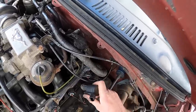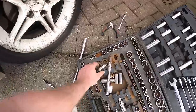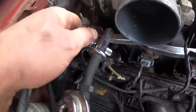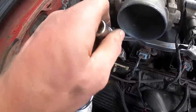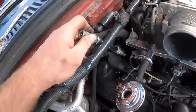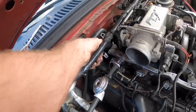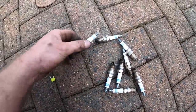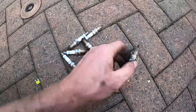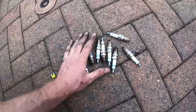This last cylinder isn't being very nice to me. So you see the trouble I just went through — someone didn't do that in the past because it's a different fucking spark plug in that cylinder, that's been in for about seven years. This is one of the worst designed engines I've ever come across in my entire life. Seriously, this is an absolute piss — I'm going to have to grind this down even more. I got them all out, nothing looks too suspicious to be fair, they all look pretty similar. One of them is a bit black which is the front right cylinder, but pretty much all okay. So let's put the new plugs in.